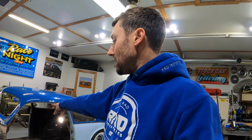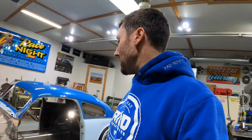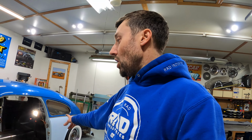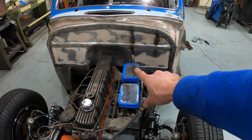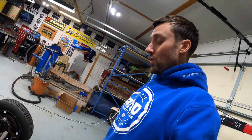And so I'm going to get this column braced up, and then I'm going to start working on that base. I'm waiting on some parts that should be here in a couple days. Clutch pedal, the rest of the parts for the exhaust, a whole bunch of fittings so that I can finish the fuel plumbing from the frame rail. I'll build a stainless steel hardline up and around the engine and valve cover here, and then I'll be able to finish the whole fuel system. I have the throttle cable that can go in at that point, and I will keep making progress on that.